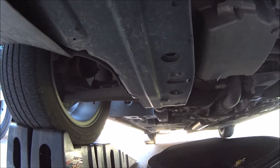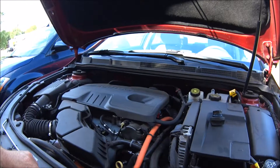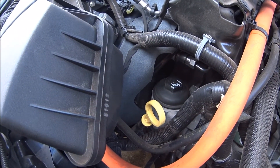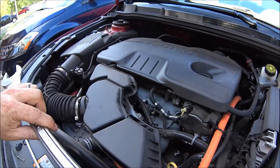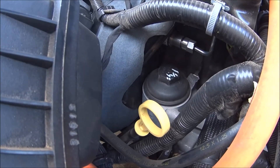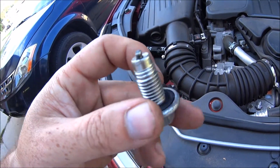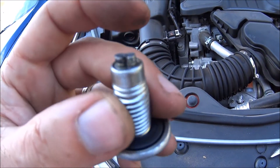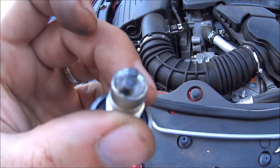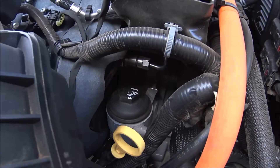This might be the little plastic piece I need to take down to get to the belt. Now top side, this is another one of those cartridge filters that I hate, but it's a one-and-a-quarter-inch socket. It's a pain to get to but that's where it is. Here's a little tip — those are just a couple of small neodymium magnets that I put on there. That helps collect any metal shavings. There wasn't a whole lot on there, so that's good. I'll just put this back in and then we'll work on getting the oil filter out.